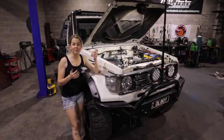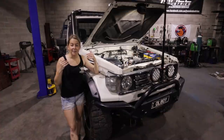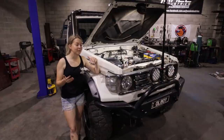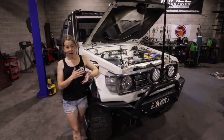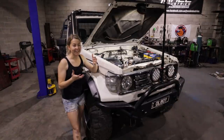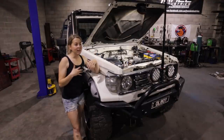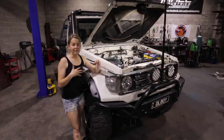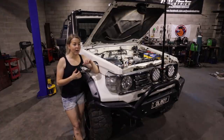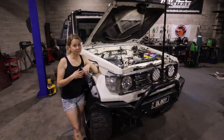I'm going to feel a lot more confident now when I start going to places like the Cape and more remote regions like the Simpson Desert, where your fuel quality might suffer a bit at fuel stations. Having those two fuel filters is going to give a bit more peace of mind. The housing feels solid, the bowl doesn't feel cheap or plasticky — everything feels really good. You can mount this before your factory fuel filter as a pre-filter, but then you'd probably want to drop down to a smaller micron for your secondary.